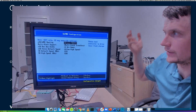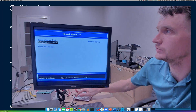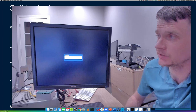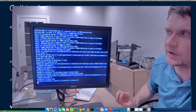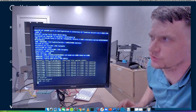There are also options for SD host controller debug settings, iSCSI configuration, and the network device list where you can set up HTTP boot — using the onboard SOC gigabit NIC. After resetting to apply the new settings, OpenBSD boots again and now it's actually using ACPI. You get the same experience — working USB. In ACPI mode it doesn't support the SD host controller yet, but these are just details.